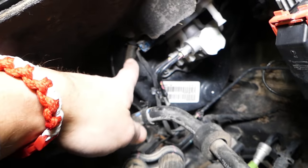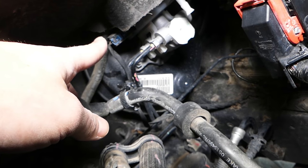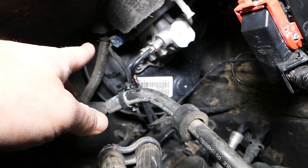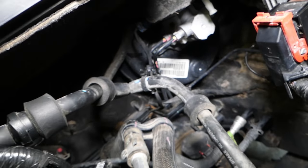What could be causing that? One thing — check the connectors and check the hoses. If these hoses are leaking, sometimes you have an elbow or a hose leaking, and as a result you're going to lose vacuum.